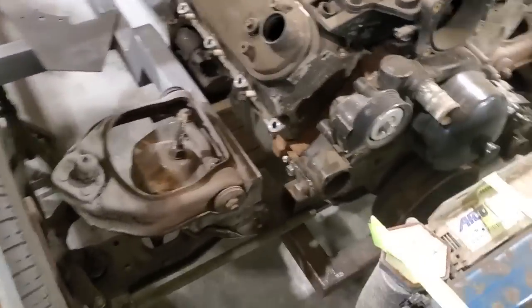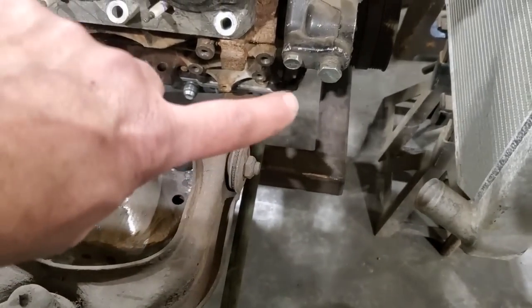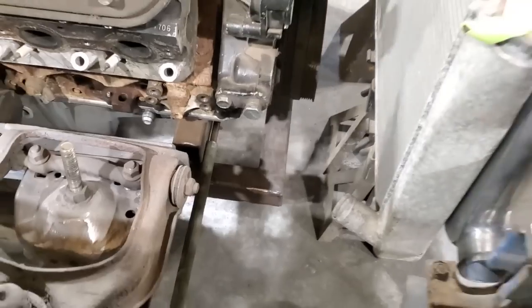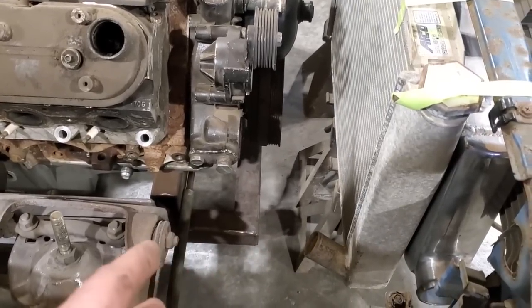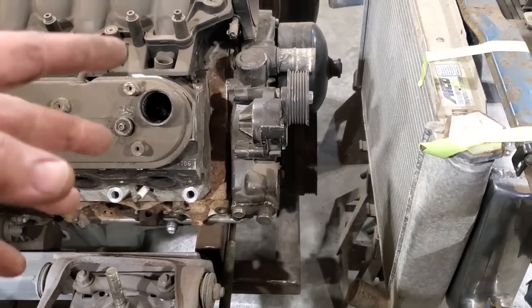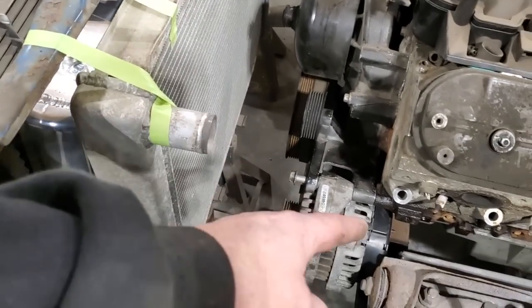And one other thing that I want to do, I'll show it on this side over here. Because I moved the motor back, down here, now the base pan starts right here, okay? And all this here is over a full inch. The rack was going to mount here. What I'm going to do is cut this off and put a new section in there and move it back. The reasoning is that I want to move the rack back tighter, and that will give me the angle going up the steering column. It just moves it back more and it goes underneath the alternator better, okay? Right now, over here, where I've got the motor moved back, the distance for the alternator is going to be tight on the bottom of this alternator if you look in through here, okay?